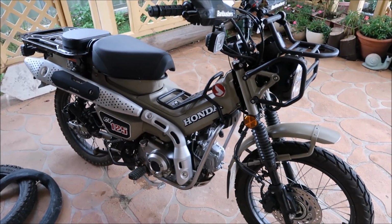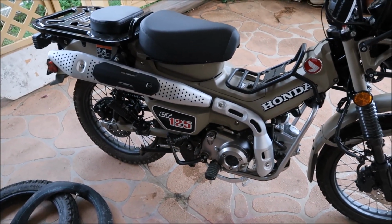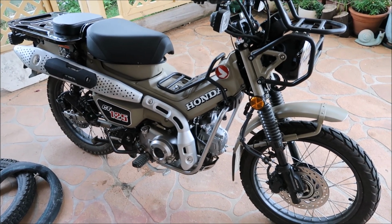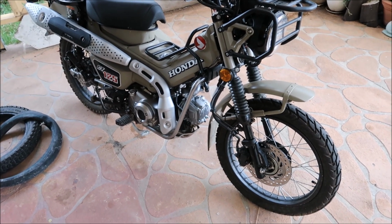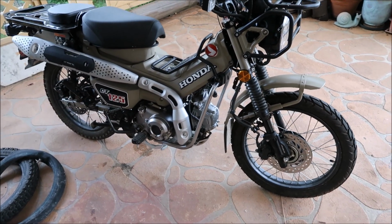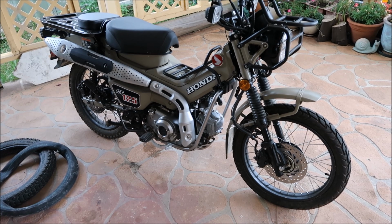So apart from that, that's all I can tell you on the update. We're back to stock standard on the front. We've got the big wider one at the back with the slime still in it. It developed a mid rear end wobble out along the road, but the front steers really well now, so there's no trouble there. So the slime, by putting too much in the front tyre, or on both of them, definitely brought in a high speed wobble, or higher speed for this bike. So you have to be careful exactly how much you put in, or it'll throw your wheels out of balance. So keep that in mind if you do come to that.